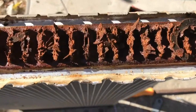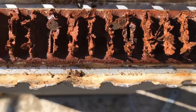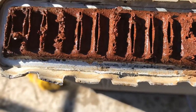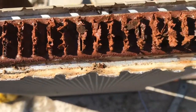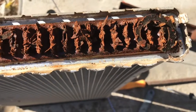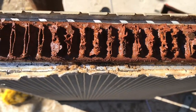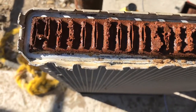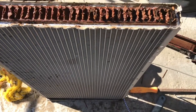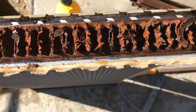Look at that guys — gasket, a whole bunch of rust particles, crud, junk. Now this thing was running hot. I don't care if you filled it up with coolant, this thing was still going to run hot. There's no circulation — this thing was probably working at only 50%. It's a good thing we flushed this unit out before we actually took it apart.